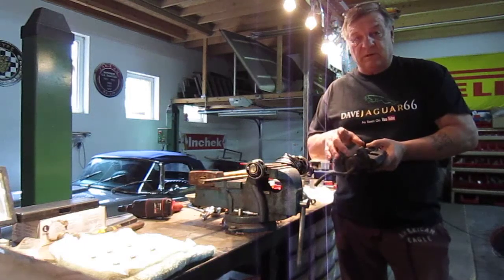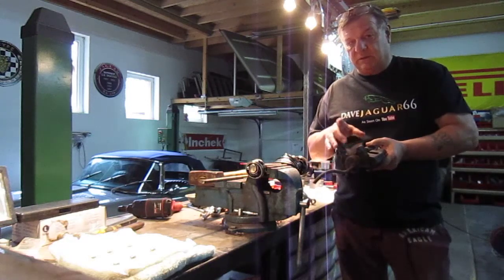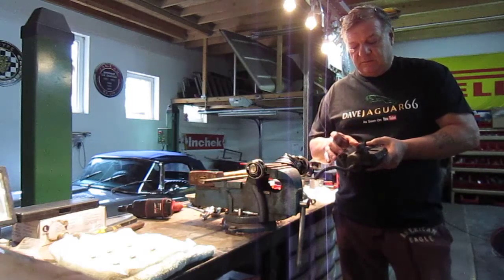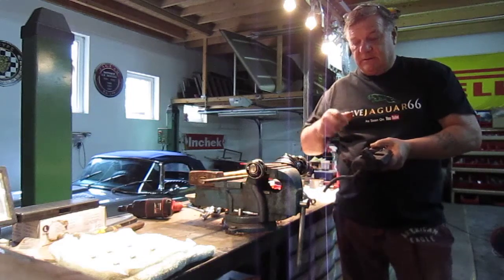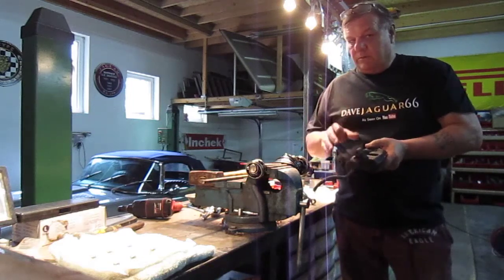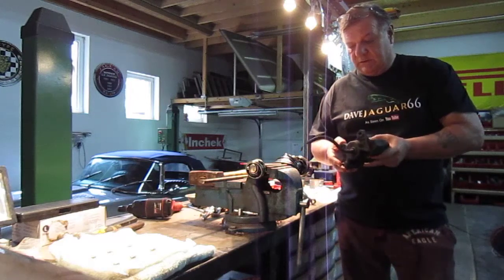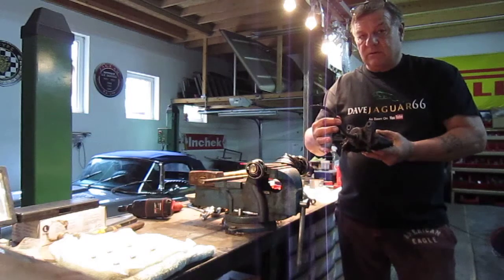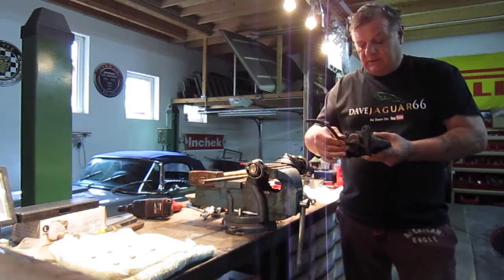Obviously, they need to be done with caliper paint, because there are very extreme temperatures in these when the brakes are being applied a lot. That's just why the chrome gets damaged sometimes. Mainly the damage to these pistons is where people take out the pads and put mole grips on them and all kinds of stuff. Some of the things I saw when I had my MOT station, you would not believe. I've seen guys come in with mole grips on these flexi hoses, so the car was only working on one caliper. But anyway, it's another story.